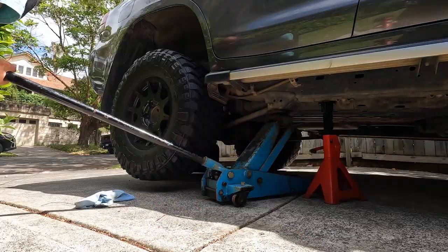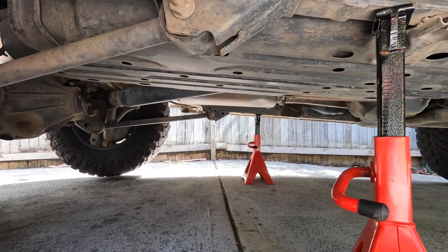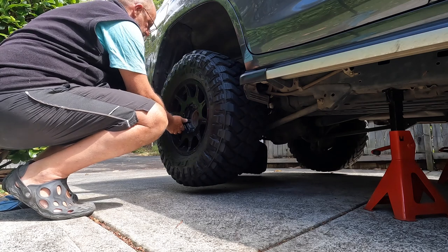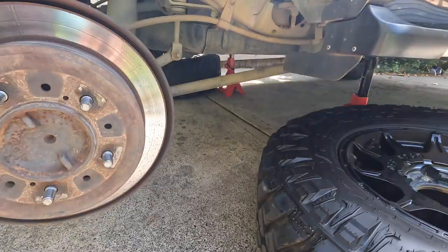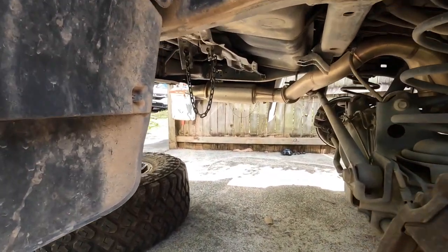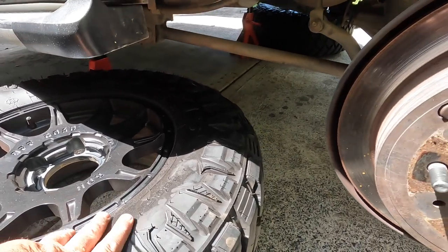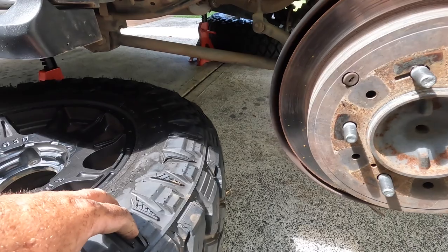You want this pretty high off the ground because what we're going to do is manoeuvre that diff around — pushing up on one side, lowering it on the other side — so you can get the springs out. I'm going to take these wheels off in a minute and put them under the car. Nothing worse than one of these things failing and dropping down when you're underneath it. So I've got the wheels off including the spare wheel under there, just to make sure we've got plenty of room to run the airlines. You can't take too many safety precautions — anything you can do to prevent an accident, that's what you should be doing.